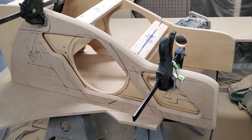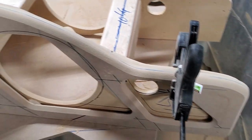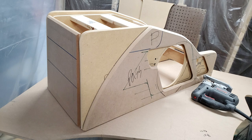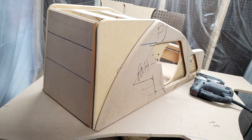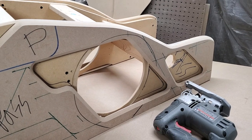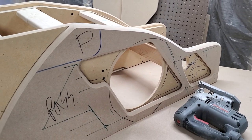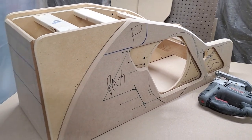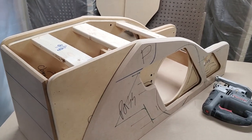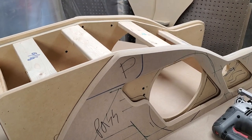This was a tremendous amount of work, mainly because it was one and a half inches thick. Here we actually made the back piece and attached it so that there was no open or exposed part of this console. We had to make a very large gap between the 10-inch mid-base driver and the front half-inch piece, and ended up routing out where the 10-inch mid-base driver was — down about a quarter to three-eighths of an inch — to make it sit more flush and give it a little more room to flex so it doesn't hit the grill mesh.